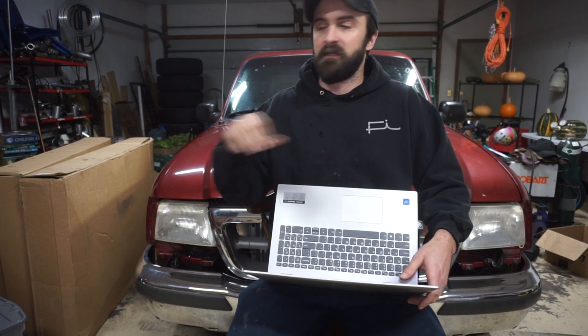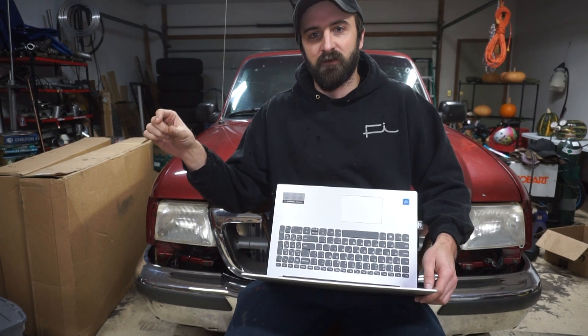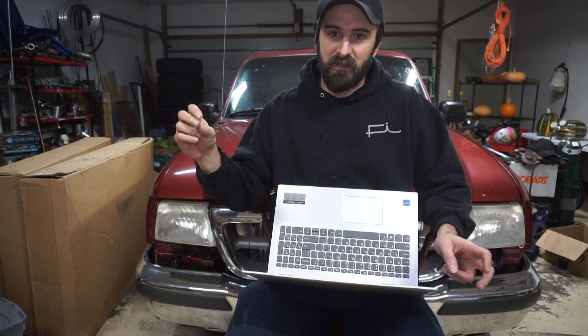So I contacted the company. It was working — I did the video showing that it was working. Next day I went out to drive it, did some pulls, and saw that the traction control was not working because the front wheel speed sensor wasn't working. I came home and spent about four hours troubleshooting it, tested the converter, and eventually emailed the company. I asked if they had a preferred method of testing the converter, and in their response they explained how to test it and said that the Holley power tap is actually not a clean signal and it typically fries the converter — typically blows out the chip.